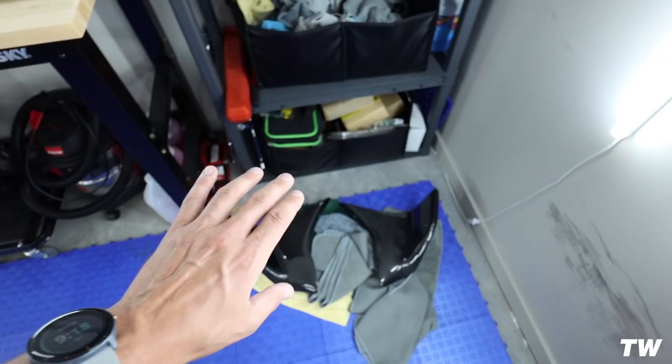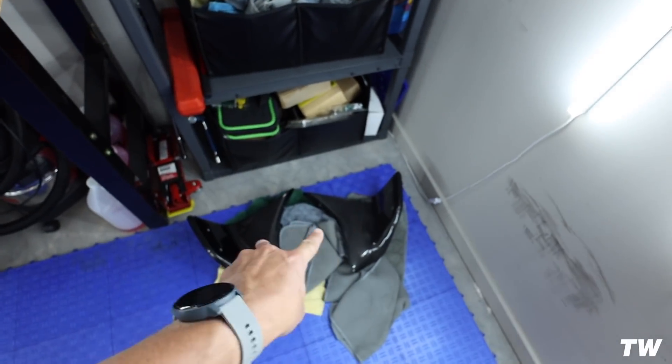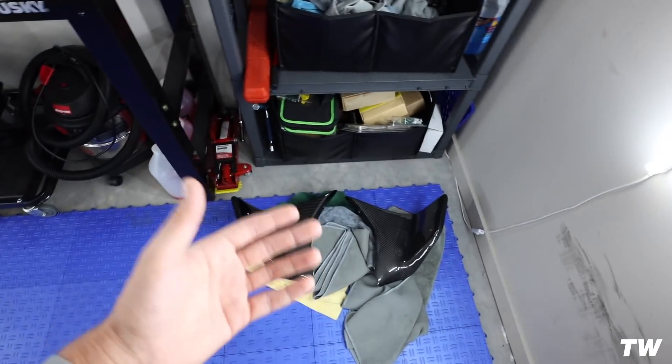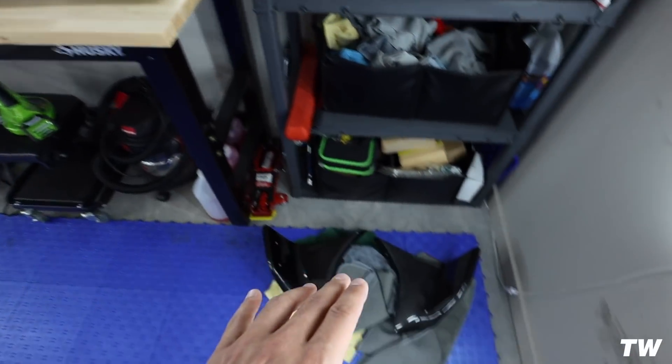I'm going to paint these sides. The thing I don't love about having all carbon is that it's really hard to work with. If this was plastic or FRP it would be a lot easier to adjust things and make it form-fit a little bit better. With carbon you don't get much flex - it either fits or cracks. There's not much flexibility. So if you're going to do this wing and you know you're going to paint these to match the car, I would honestly just get the one with FRP plastic sides.